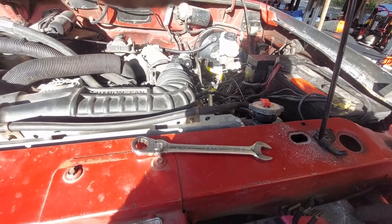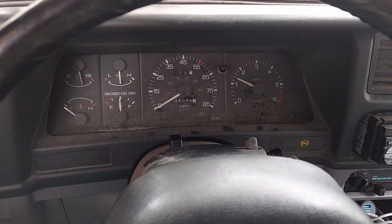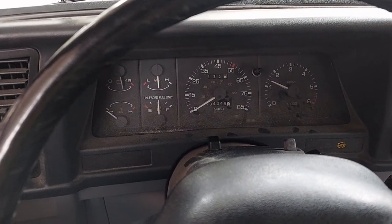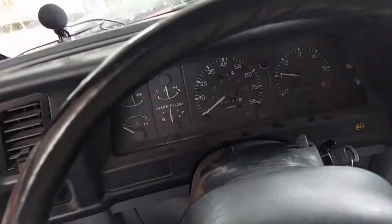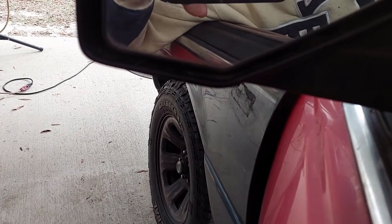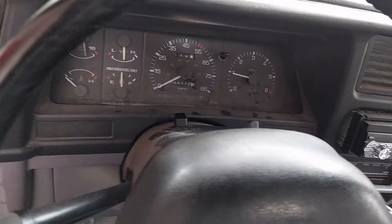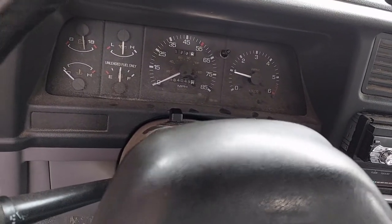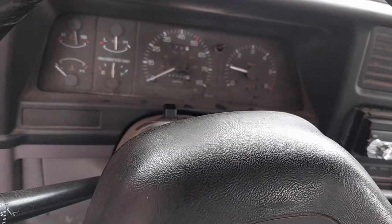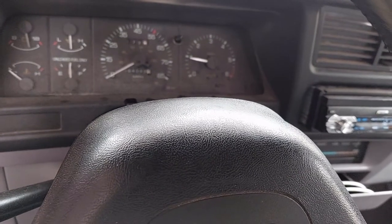It's been a couple of days since I did the last video segment for this episode. I've been tinkering with the amount of adjustment on the steering box and I think I've found where I'm happy. Right now I don't have to move the wheel much and the tires are responding and moving. I had to back it off a little bit because the steering wheel felt a little heavy, and I also found there's just a little bit of center play that's going to be there no matter what — I think that's because there are some worn components on the intermediate steering shaft.